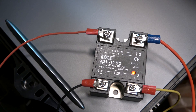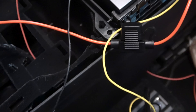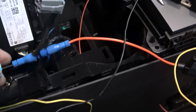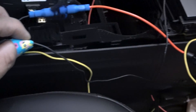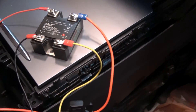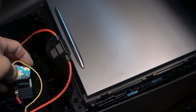This is the hard part — this is how you set up your relay. Pin two is where I put my blue wire, the constant power wire. Pin four is my ground wire. I got a solid state relay that can handle low voltage, low amp input, because some relays won't work with this brown wire. You can find the link in the description below. Pin three is where I connect the brown wire from the back — the OBD brown-white wire that comes up through the armrest as the yellow wire. This is relay power, so the whole thing turns on when the relay turns on and off when the relay is off. Pin one is what I use to power my accessories — this is switched 12V. This relay is small enough to fit in the small hole, so I'll put it in there to keep it less messy.